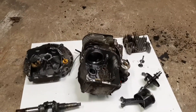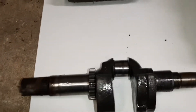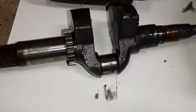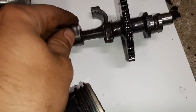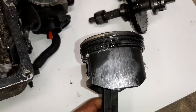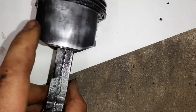So I got the engine disassembled, and as you can see there's still a lot of gravel and sludge inside of here. When I look at the crank, it's actually in decent shape — it looks like it's in pretty decent shape, which I'm blown away by. The cam lobes look really good, the tappets look really good. Now the piston — I'm going to try to wipe it down — that's pretty tore up. The piston did take a beating, scored up pretty bad. There's even shavings and stuff.